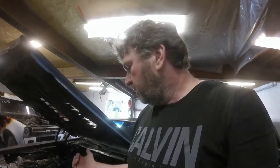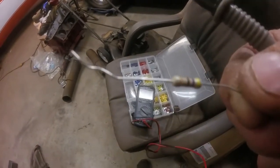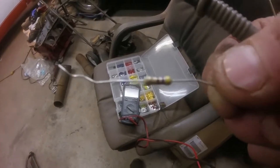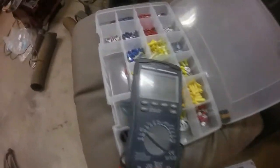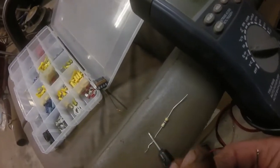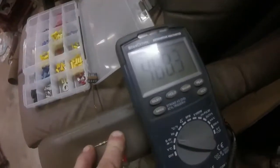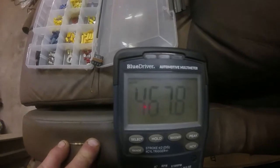So what we're going to show you is how to wire a resistor into the alternator circuit. This is the resistor we're using — they're really cheap, probably like 25 cents each at the parts store. We've got a multimeter here, and we'll put the two wires across it. As you can see, it reads 467-468 ohms — so that's basically 470 ohms. We measured it before we soldered it and we measure it after just to make sure the resistor is still good.